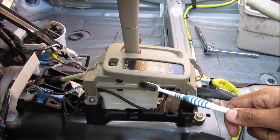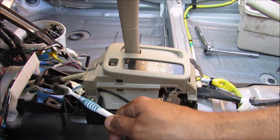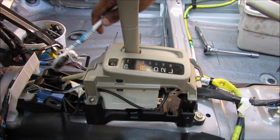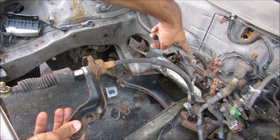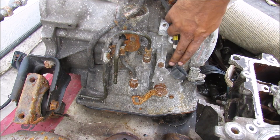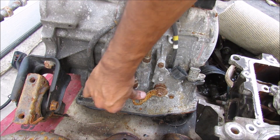This is an electronically controlled unit, so we've got a shift control ECU over here. We've got the wires that go out to the brake light switch as well as the key ignition switch, and then we've got this cable that goes over to the transmission to change direction. Under the hood you can see the cable where it comes from the firewall and connects to the transmission. On the front of the transmission we've got the park neutral switch as well as the lever where the cable attaches.